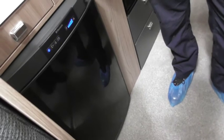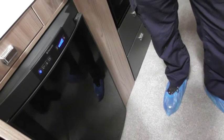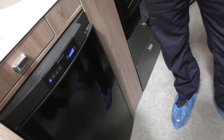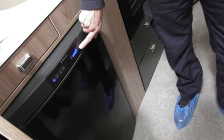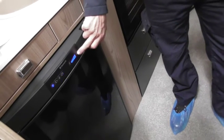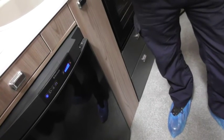If I press the battery one now - that's the same as your caravan, that's 12 volts coming from the vehicle. So obviously when that operates, when the engine's running, that will shut off. If that's operating on the gas side, that means the gas hasn't lit. So if that started beeping at you and flashing, the gas has failed to light.